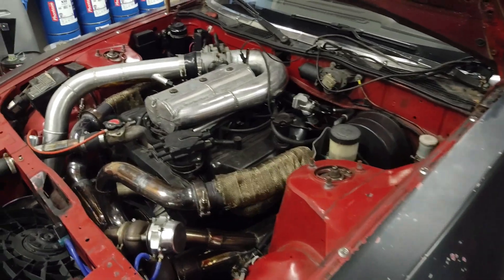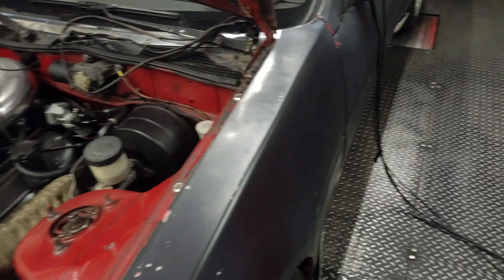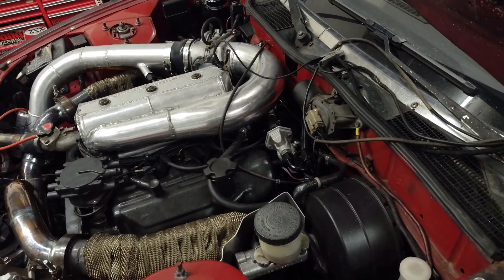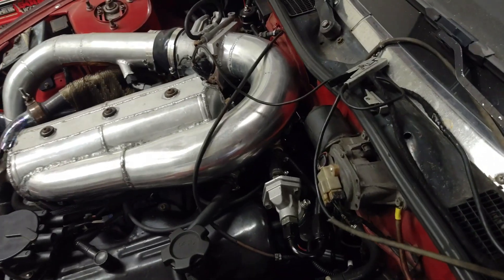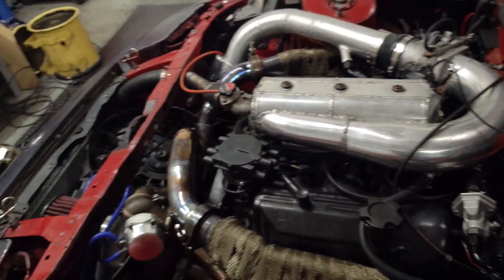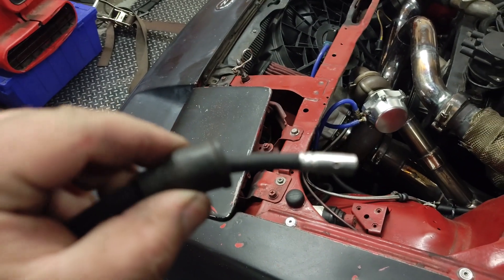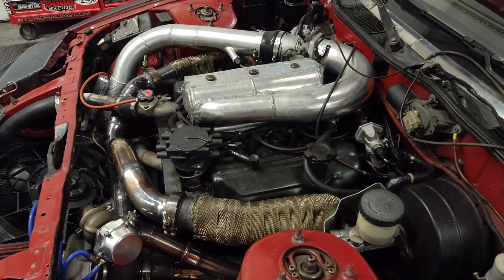Taking a quick break from the tuning because I'm having an ignition breakup problem. I noticed with my coil packs at the back of the motor — I just so happened to be looking and I could see it arcing from one of the coil packs to something metal down in here. So I decided to take one of my plug wire boots off, and this boot has a hole in it.